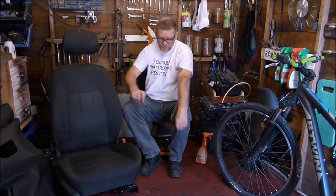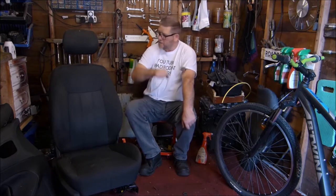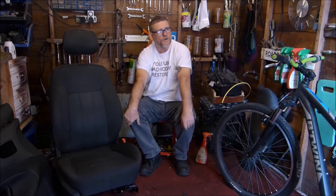That is how I removed my driver's seat from the Ford Mondeo 2008 1800 diesel — pretty simple really, just four bolts basically. You do have to have the special Torx tool to undo the bolts. A lot of you will already know how to do this, but there are some people out there who want to give it a go, so I've just shown you how I did mine. The last time I took a car seat out was in a Montego — my taxi — I took the whole interior out and swapped it for a valet interior.